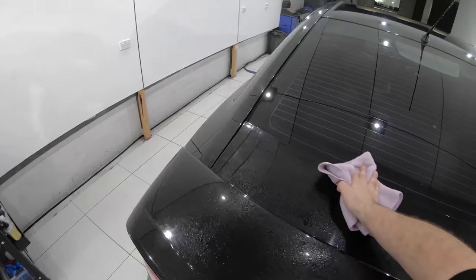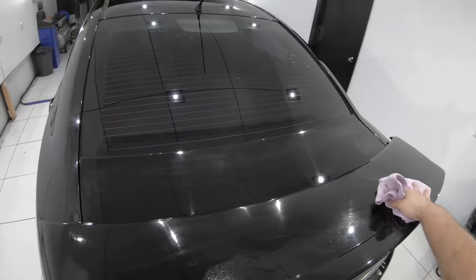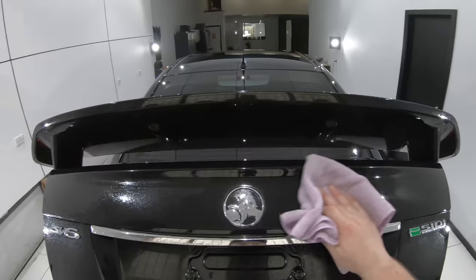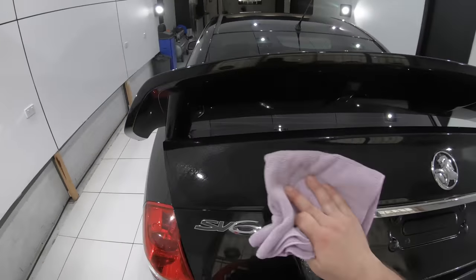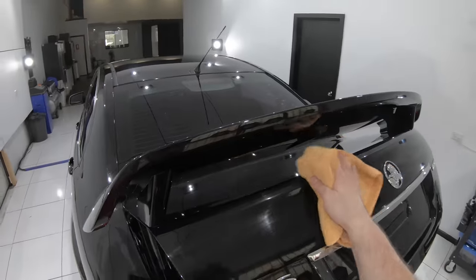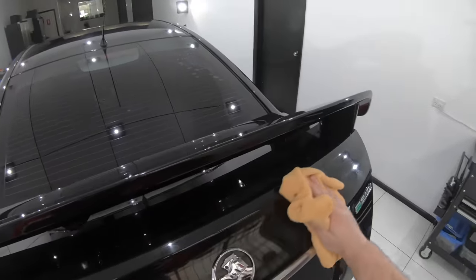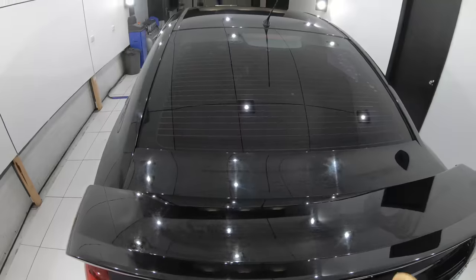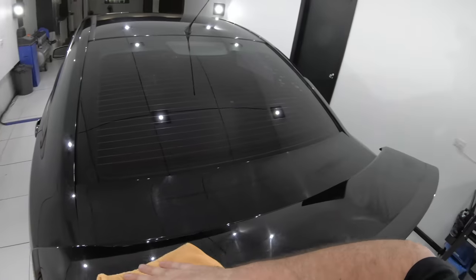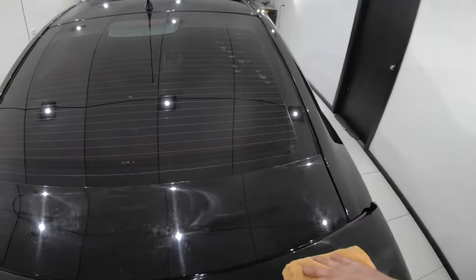A damp cloth with water on its own can also absolutely help clean polishing oils. But the issue is that it takes a lot of wiping to dry straight water off a panel. So water with even just 5 to 10% alcohol tends to be a better light cleaning and drying solution overall. Another great option for polishing those soft and sensitive paints is to use a primer polish that doesn't require an IPA wipe down, but it still leaves hardened and slicker resins behind that will significantly help reduce any wiping swirls or marring, while still enabling paint protection products to bond to it quite effectively.